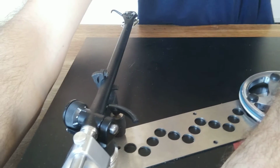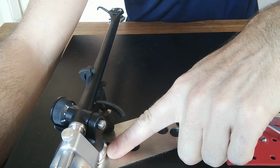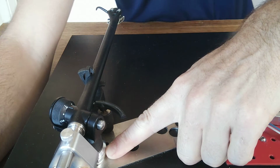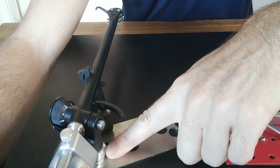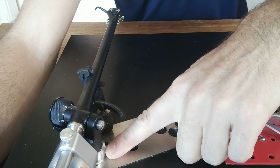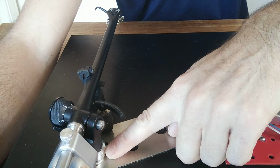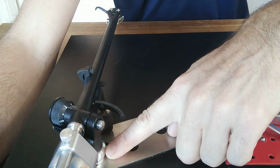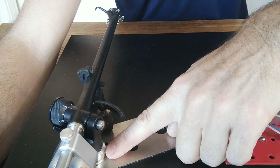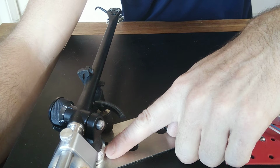And then the other thing I've done, if I just rotate round slightly, sorry for the wobbling, you can just about see there, that's an adjustable height, vertical tracking alignment. Now it is possible to buy washers so that you can raise the height of the arm. This is quite important as you change cartridges, because cartridge bodies are different heights. But I didn't want to be dismantling my arm every time I put on a thicker record maybe, or change the cartridge. Not something I do very often, but you know. But I wanted an easy way of getting the vertical tracking alignment correct. So having an adjustable height was a real benefit.